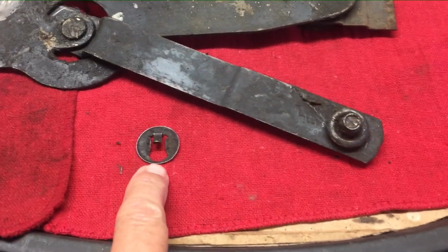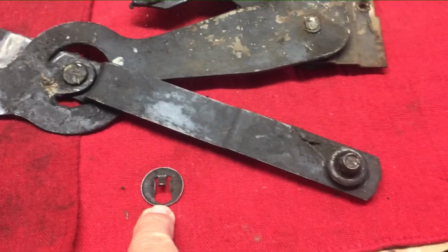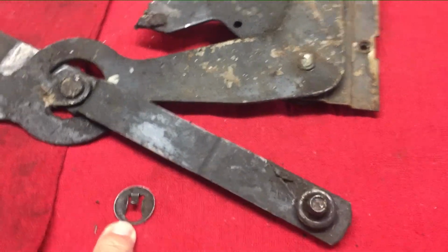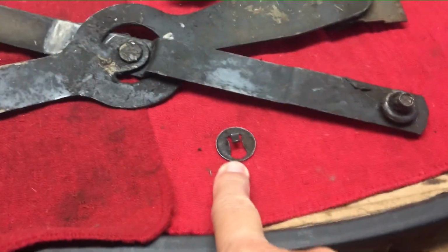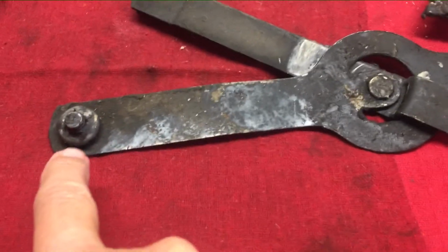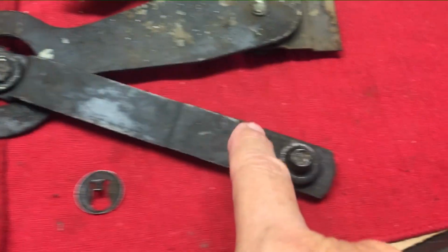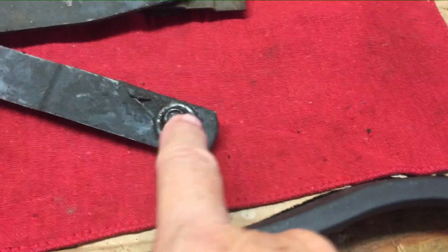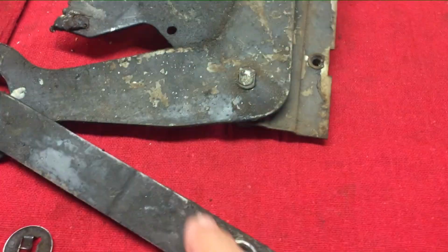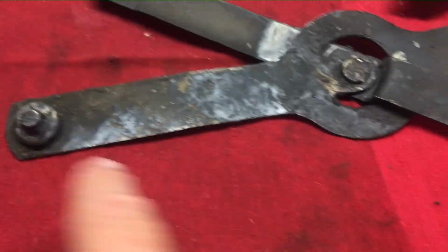Because if you have tried any of that on this, first, it's very difficult to get any tool in there, let alone your hand, to remove this clip. So I don't know how they went about doing some of these things that they've described. And they even said that sometimes they rust. They say, well, you got to cut it off because it rusts. Well, as can be shown, most of the window regulators I've seen are covered in grease that people have applied over the years trying to make their regulators work.